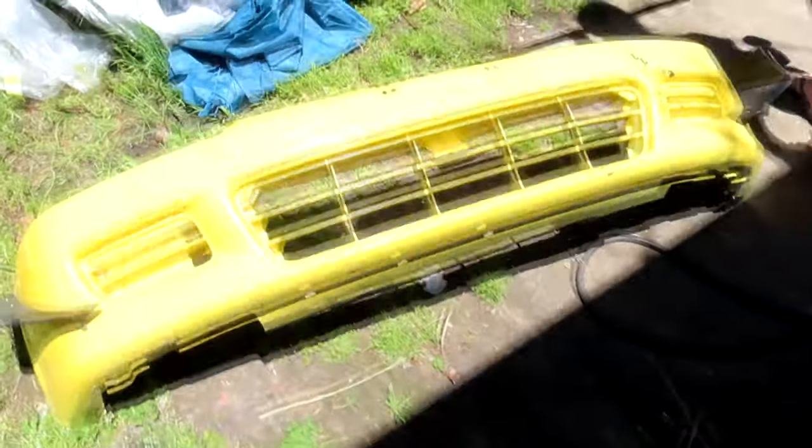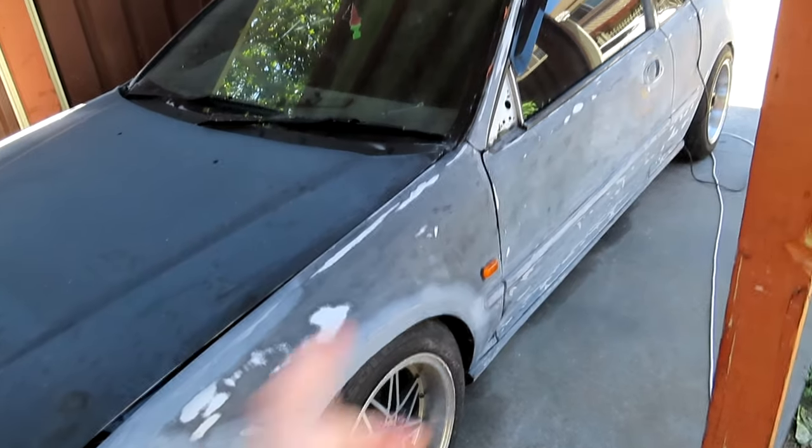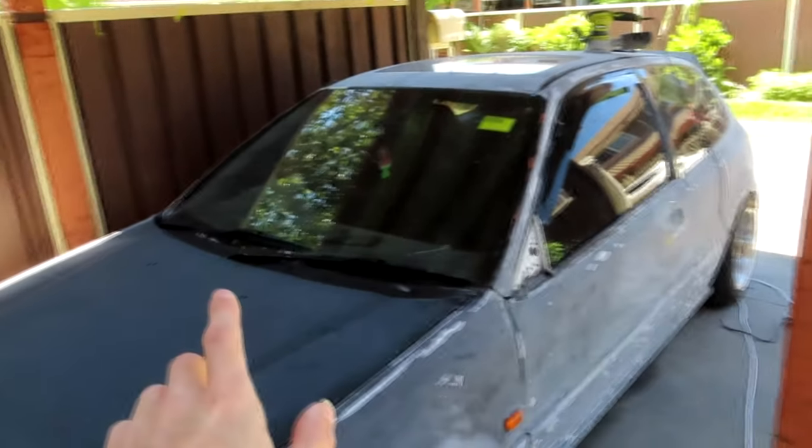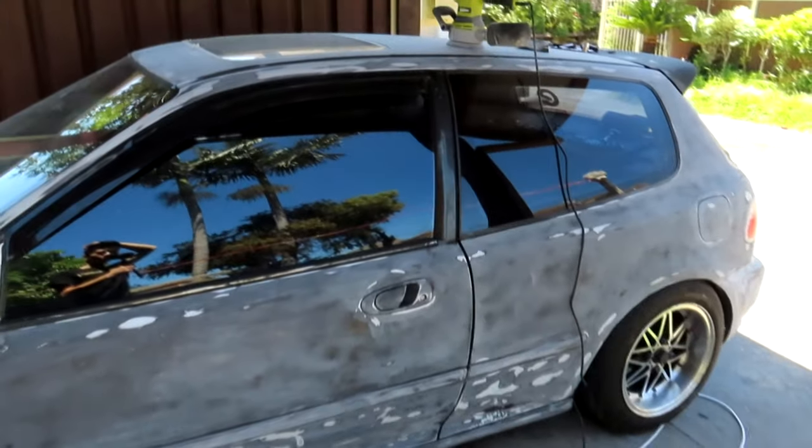Kenny is just removing the parts off the front bar at the moment, and I'm doing a bit of repairs on this side. I did fill this area — there was paint cracking here on this fender. I don't know if you guys remember seeing the fender being cracked from the damage before, but this fender has to be repaired. Once everything is sanded back down, we're going to double check for anything that needs repair, fill what needs body filler, then prep the whole car with tape and get ready for paint.